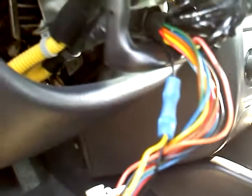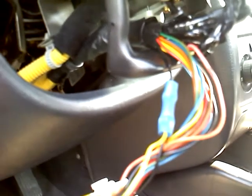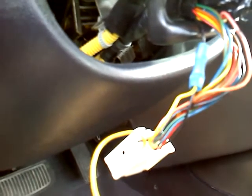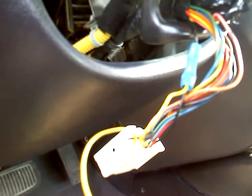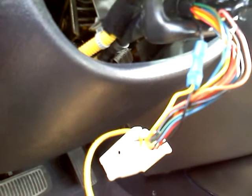If you want to solder it in to make it look a little cleaner, you can do that. When I got it connected, I reconnected the battery and did a test. It works with the parking lights on — you have to engage the parking lights, and then the fog light switch works completely independently. The fog lights will turn on and off with just accessory or key on, engine off, or engine running. The fog lights are 100% completely independent from the headlights at this point.